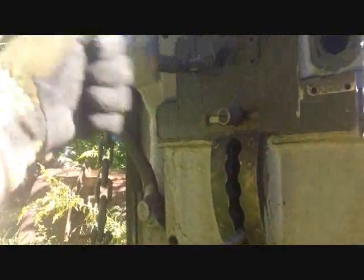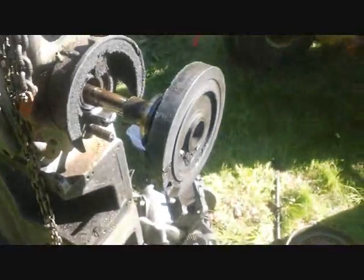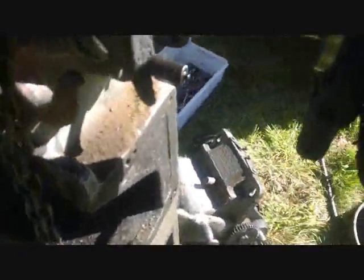That didn't seem to do much, but then I noticed this whole thing would slide out if the inner part there was not engaged by this shifting fork. There's a bolt right here that it pivots on — that can be removed — and then there's a pin right here that attaches it to the control rod that goes up to where that lever is. Basically you turn that lever to engage the clutch and it moves this rod in and out. After driving the pin out and taking out the bolt that was the pivot point, I can just pull the whole thing — it slides out, and it looks like that's a big bushing that came out of that sleeve right there.